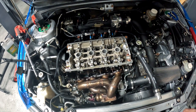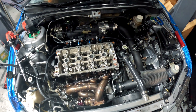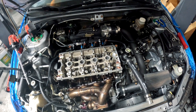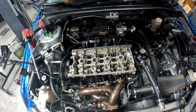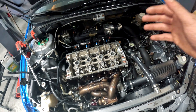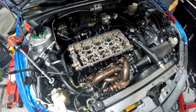There's an HLA there like I mentioned, which is good. We're going to take the cylinder head off, look at the surface of the head and the block, look at the pistons, and then we'll end this video. We'll come back to this whenever we get the cylinder head back and put it all together. There will be a dyno video for this particular car.